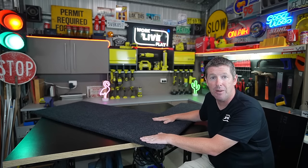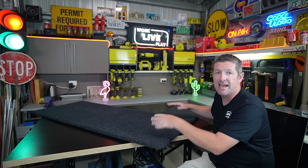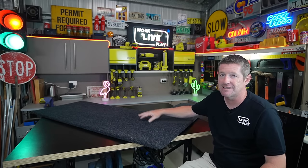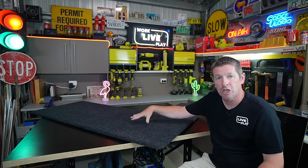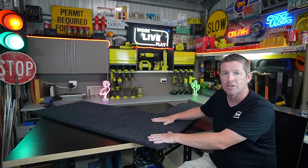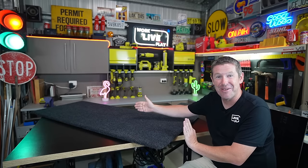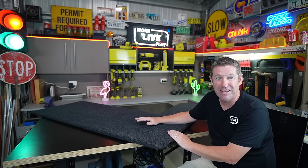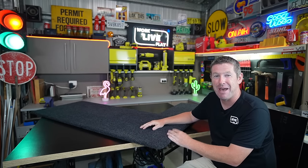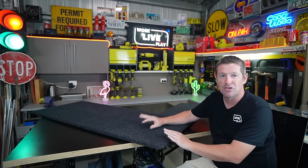To confirm the length if you're replicating this in the back of a next-gen Wildtrak: the actual length is 1,445mm. I was out 5mm in my quick measurement, but taking into account the carpet, 1,445mm is a really neat snug fit in the tray of the Wildtrak. In most cases you'll trim the whole board, put carpet on, and then bolt your fridge slide down onto it. If it's tightly fitted, the weight of everything should generally take the cantilever of the fridge slide when it extends without needing to bolt it all down.